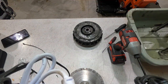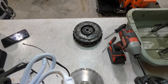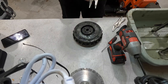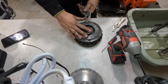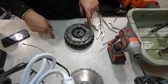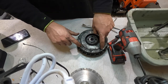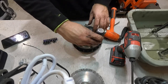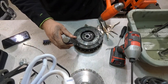Let me grab a pair of small vice grips and see if we can't just break these heads loose, just to get a look at what's going on. Because what it's looking like now is we're going to have to replace that whole entire primary clutch. If I can't get in there to service it, I don't want to mess up my solvent tank trying to salvage this thing. Let me grab my Dremel and cut some slots into these because every one of these is stripped out. Actually, let me try my impact driver first.